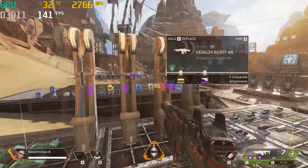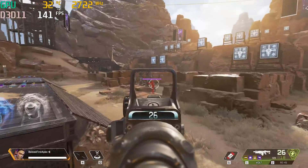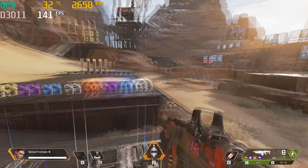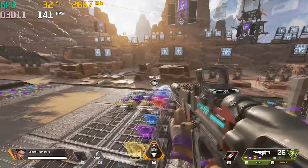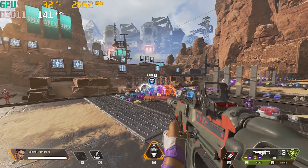When I was playing Apex Legends, it was able to hit over 2.7 gigahertz — I saw as high as 2.77 gigahertz. I was able to dial in 2.8 gigahertz for my max boost clock, which is absolutely incredible, and it actually started to scale with it. My overall score compared to stock ended up being about 10% faster, which puts it roughly on par with an RTX 3090.